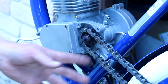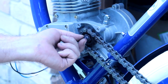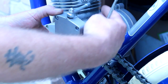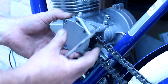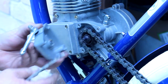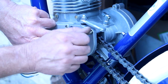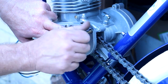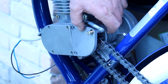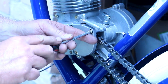We're ready to go ahead and put our sprocket case cover on with the clutch arm. Make sure that this metal pin here has not come out — it has to be in there, it's got a little dab of grease on it. Your clutch arm needs to be somewhat out a little bit — you're not going to try to put it in with it facing in towards the motor. Have it at least facing to the back and out a little bit. This here is going to be actuating that rod — this arm turns and presses on the rod, which disengages the clutch. Start with the longest screw first — that goes in the upper back one. The reason this one is so long is it comes through the back and this is where you can mount the chain guard if you wish. You want to get these good and tight, but not too tight — these screw heads are kind of soft, so don't strip them.